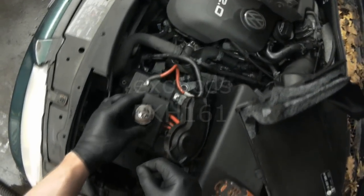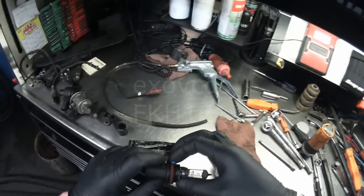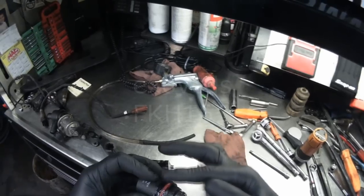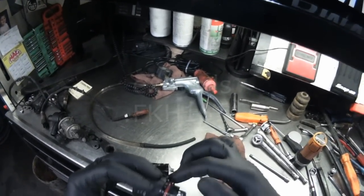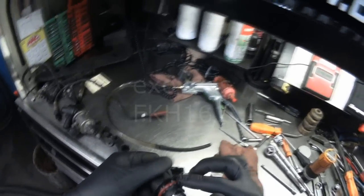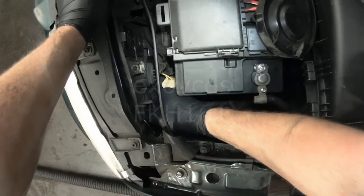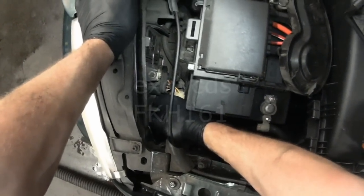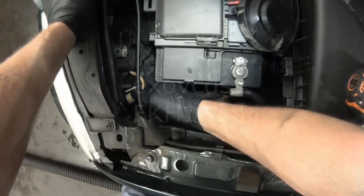You can see there's a little bit of rubber grease on the O-ring. The O-ring can be slightly different in size between manufacturers and can be a real pain to install. But when it's greased up a little bit, it goes in really nicely. Just be sure to push it in straight — you can watch through the lens housing to see if it's coming down the middle. Once it's popped in, put the collar nut back on and reassemble in reverse.